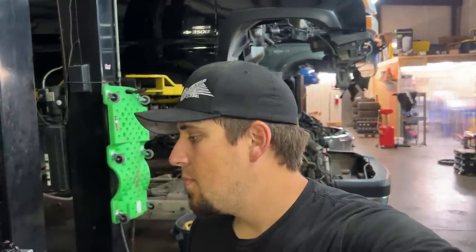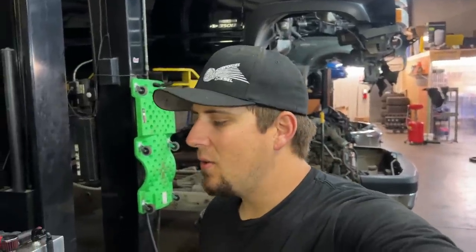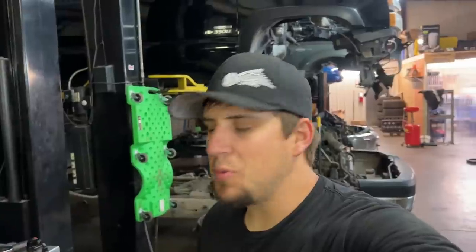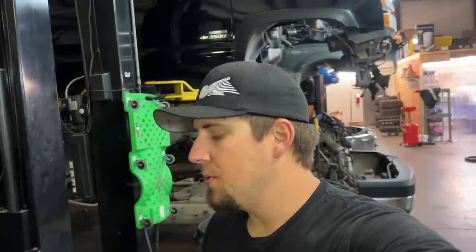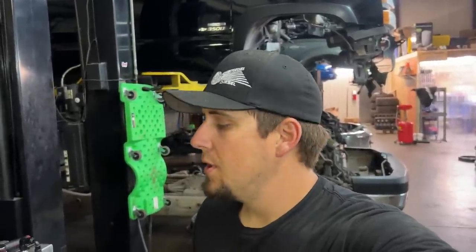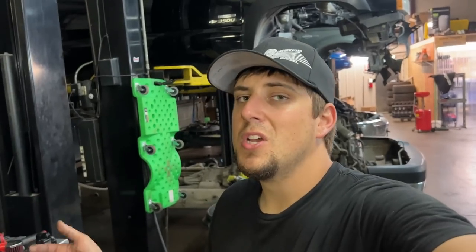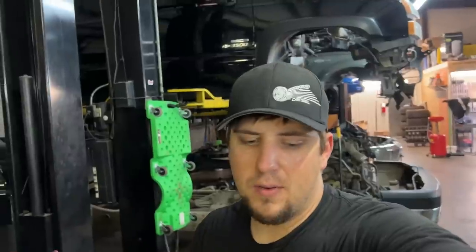We're gonna put it back together. I did two hot retorques, but the second one, I didn't have a chance to drive it. I just spooled it up twice and called it good, loaded it on the trailer. So I think what I'm gonna do to rectify this issue is put the head on, torque it, get it hot, no coolant, torque it, and then go do a couple of test hits on the street, 20-30 pounds boost, torque it, and then maybe check it one more time after that, maybe with the deck plate or the head studs we're using, whatever, maybe that's causing an issue.